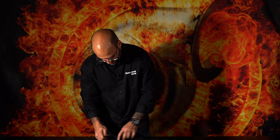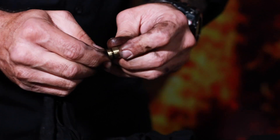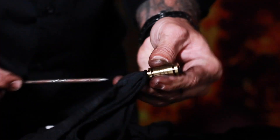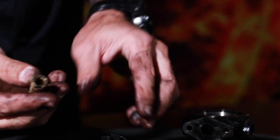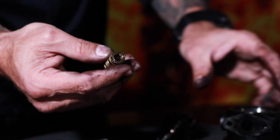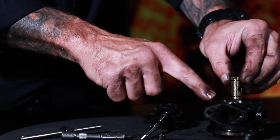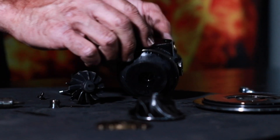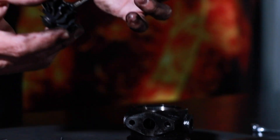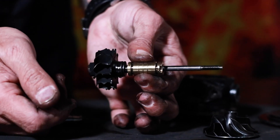I'm going to clean this bearing up and give you a closer view of what has happened. You just take a thin piece of cloth and pop it into the bearing to give it a wipe — not the proper way to clean it; you'd obviously need a paraffin bath — just to get any dirt away. Now let's get the bearing onto the shaft in the same orientation it would be installed. The compressor side is where the back plate came off; the turbine side is where the shaft went in. The bearing comes out and fits onto the shaft like that. The bearing is held in place and the shaft rotates inside of the bearing.